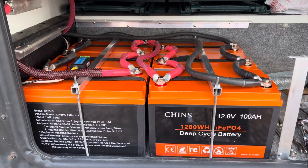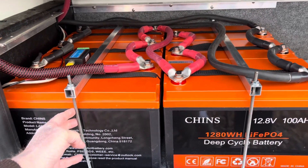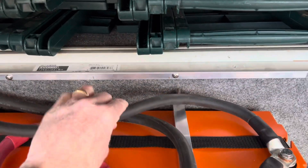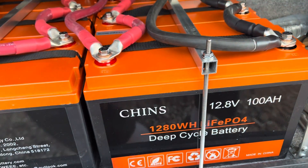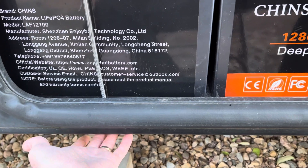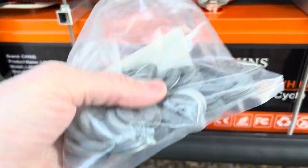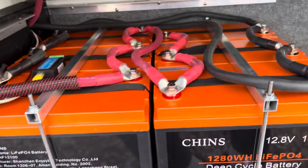In the previous video I went over the mounting for the batteries — those threaded rods in the front and a couple in the back behind the cables. This has got 3/4 inch aluminum tubing I bought at Home Depot and cut and drilled as necessary. It's stainless so it doesn't rust, since it goes down underneath. I used stainless nylock nuts and weatherproof washers — they have rubber on one side and stainless steel on the other — for compression and to keep moisture from wicking in.